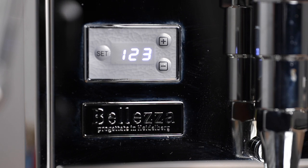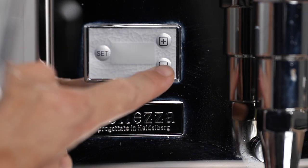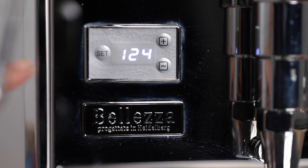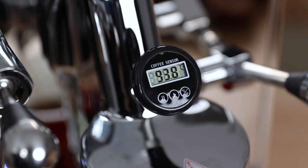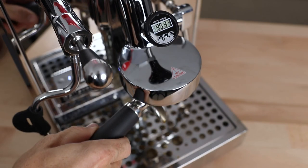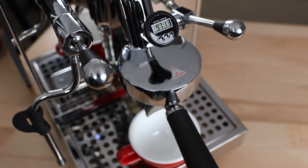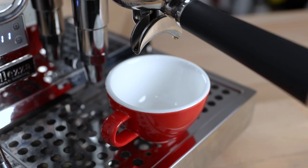On the Belezza Chiara for example, the set temperature of the boiler — which in this case is a PID only on the steam boiler — meant that for every 1 degree Celsius I raised the steam temperature, it affected the brew temperature by half a degree. So I calculated my ideal steam temperature to be around 120 degrees Celsius in order to get a stable brewing temperature at the group head of 94 degrees Celsius during brewing. There was some flushing of the machine still necessary prior to pulling a shot, depending on how long I left the machine idle. I did notice there was also a tiny bump in the temperature of the shot around the halfway mark of pulling it, but I did find this was the sweet spot for the coffee I was using.